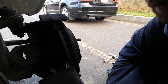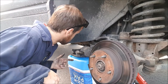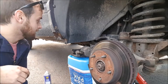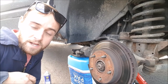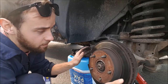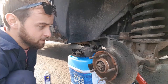Just like that, we have it loose. You don't want it to hang, so prop it up on something so you don't damage the brake line. The next things we need to do is remove the disc and get our old pads out of the caliper. My old pads do have lots of brake left, but it looks like they are a little bit damaged - I guess they were low quality. This is also where you have to watch out because if you've been driving this will be really hot. I've been sitting long enough so it's only warm now, but it should just come right off.